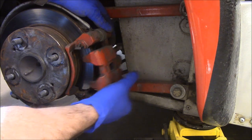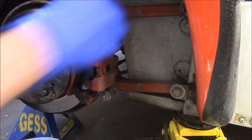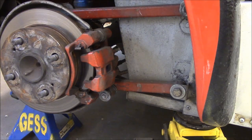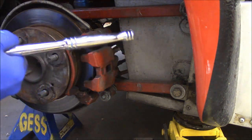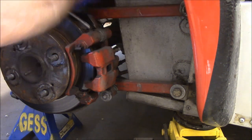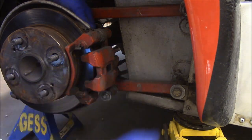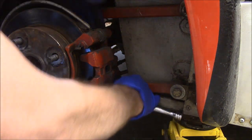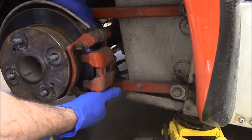I'm not happy with the way this is going. We're going to ramp up the guns here — take the whole caliper and caliper bracket off with a socket I didn't bring. Got a ratchet, got a socket, make sure it's in the off direction. This is the brake caliper bracket bolt. Removing these — one on the top, one on the bottom — to help me get the brake caliper off, which should help me get the rotor off. I can check to see if the rotor is warped.